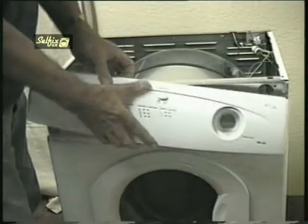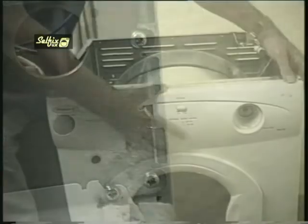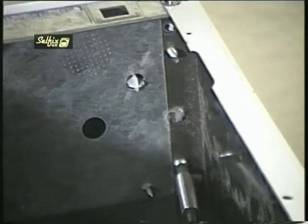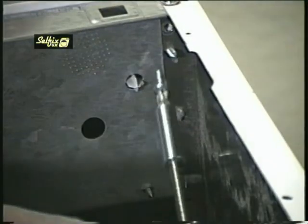If you have more than one switch then make sure you connect the correct wires to each one. Hook the lip on the panel into the bracket on the cabinet and replace the screws — be careful you don't drop any of them or you could have a job retrieving them. For awkwardly placed screws like these, a magnetic tip screwdriver can save you so much time.